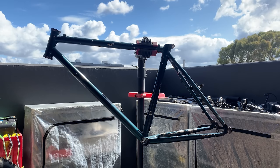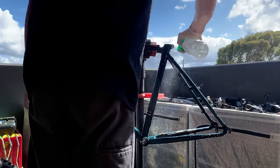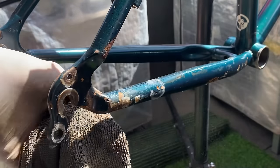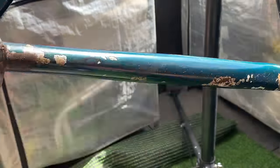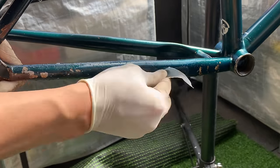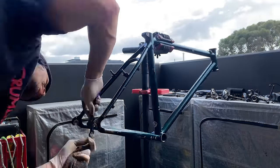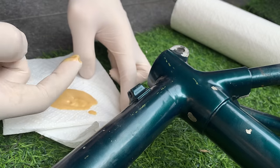Here's the logo — Park Forks Factory Racing. Cleaning up the frame now. Basically what I do is brush it down with a nylon brush or use a little bit of soap and water and then just spray it down and wipe down the whole frame. For tougher areas I like to use a little bit of WD-40 and a wire brush — sometimes that helps get rid of some of the rust. This rear triangle was pretty rusty. Getting some of the gunk off where the chain stay protector was. Sometimes I use sandpaper too if it's real tough — just 600 wet and dry — that really helps. Just be careful with the paint of course, depends on your goal.